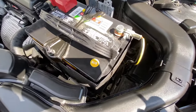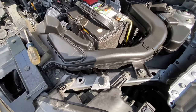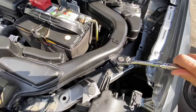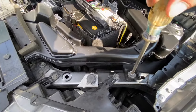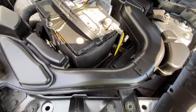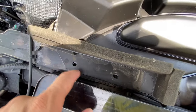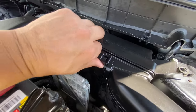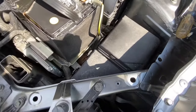There you go. The second fuse box is located right underneath this filter. To take this filter off, there's a screw right here. I tried using a screwdriver but mine didn't work, so I'll use a 10 millimeter. All you do is loosen it. Once you do that, you might have clips here — I don't have them, but you might have to take the clips off. Once you loosen this, pull it up carefully and that comes up. Now you can get to your fuses.